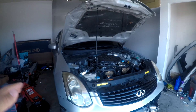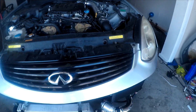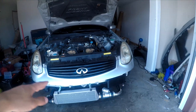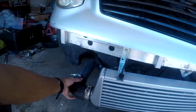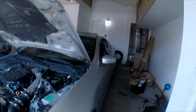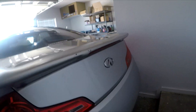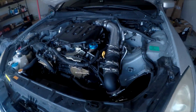That's pretty much how to turbo any car: mount the turbo to the exhaust, route the charge air into the intake with piping. You can have a shop fabricate this stuff for you if you don't want to use a bunch of couplers and cut and route everything yourself, which is what I did. I had an exhaust shop do my exhaust so I could mount the turbo using V-bands. My setup is really custom so it's a little janky in some spots, but I think it's pretty cool.